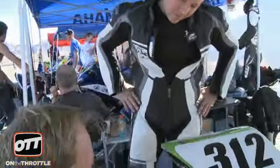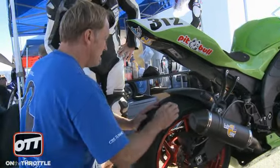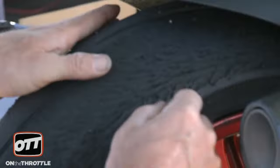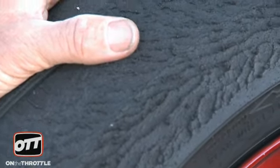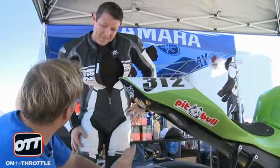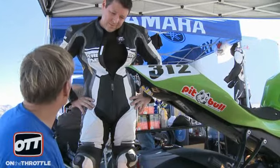The reason that, when there's a spring problem, this here will actually look like a salmon fillet. When you overheat a tire, everything melts into the middle because of the centrifugal force — it's going to spin it into the middle. But what I really don't like is on this edge of the tire it's a V, and that's usually indicative of a spring problem — either not enough install preload, too much, or it's just the wrong spring for this track. I have a serious concern there because it literally is a V, and that's indicative of a spring problem.